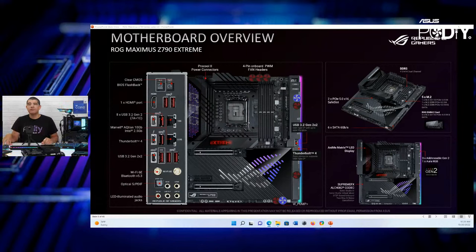Okay. There's also some other kind of cool functionality in terms of aggregation, in terms of the way bands work. You can actually combine two bands together that even have more throughput. So if maybe you have a multi-gigabit ISP service, you could actually even have a higher level of throughput speed available to you. Although with Wi-Fi 6 and Wi-Fi 6E, you can already achieve greater than 1 gigabit wireless throughput. It's actually not even that unrealistic to be able to see 1.5, maybe even almost 2 gigabits in terms of wireless throughput, especially if you're matching it with one of our Wi-Fi 6E based routers. So that is a pretty cool design specification.